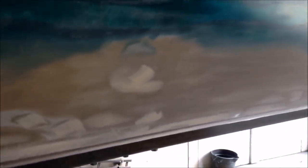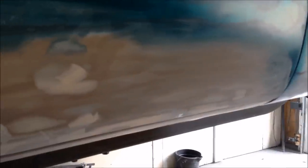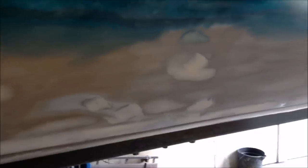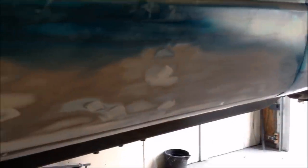Since the scratches and grooves that the disc puts in are pretty minor, after I did my body filler I was able to go straight to 180 grit. By using the 180 it's ready for primer right now — just one step of bondo, pretty easy. Just one more thing done before we move on to primer.